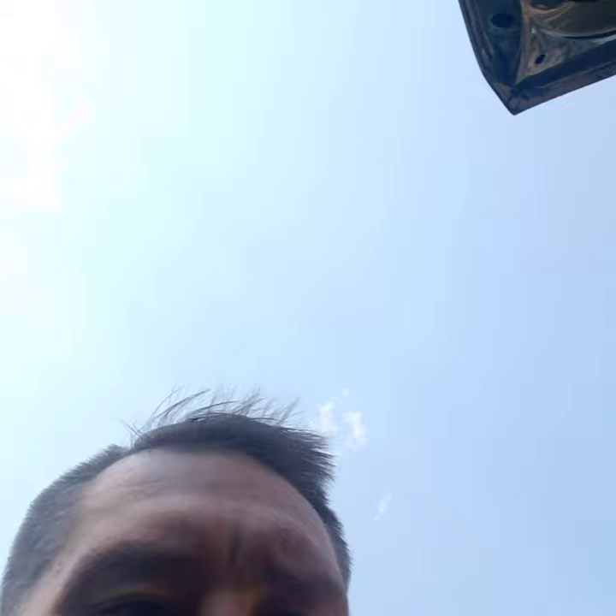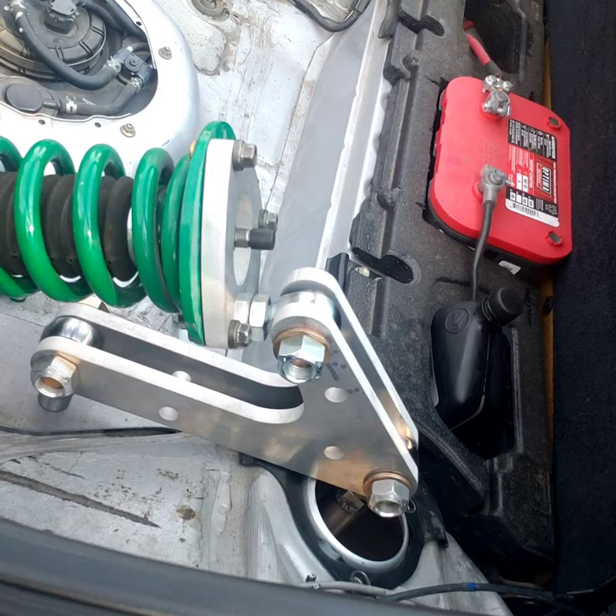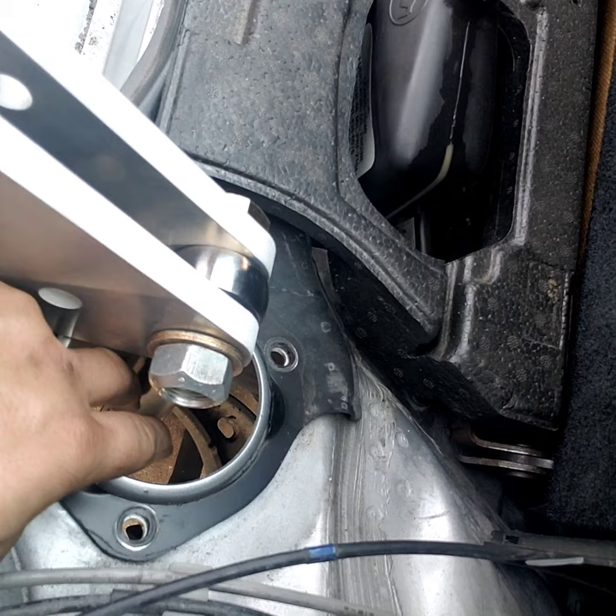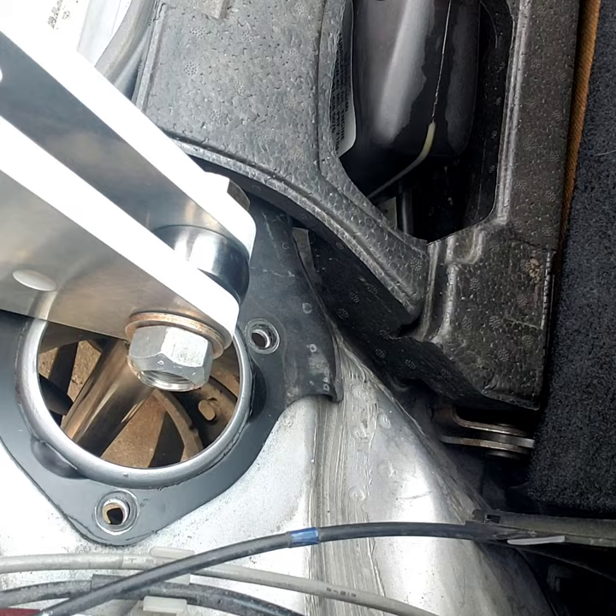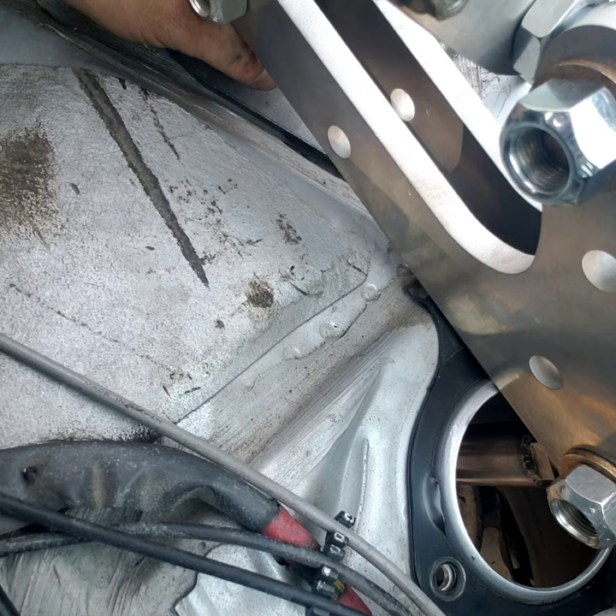There's the push rod suspension — not centered yet, I still have to get this piece welded in. I'm thinking I should notch it so it's not sitting so low, or I can raise this side up. My concern is all the weight on there — there's not a lot of weight in the rear — so I have a feeling it's really going to change the ride height significantly. I could adjust the coilovers obviously, but the push rods themselves... I'm not sure.